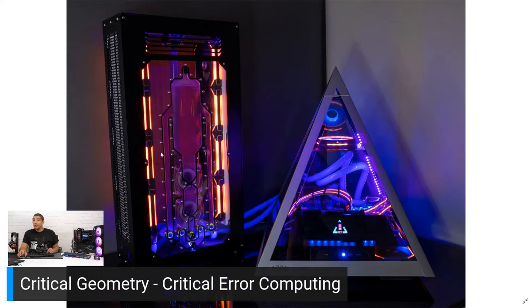But we're going with a full external radiator setup. And from the size of that external rad, I don't even think it's a 480, that might be a 560 radiator, which is massive, right? So we've got tons of cooling performance, which also means that hopefully we should be able to keep those fans super, super low, ideally maybe sub 1000 RPM. So you effectively have almost silent operation for an extremely high level of thermal dissipation performance, right?